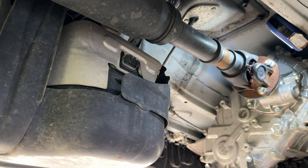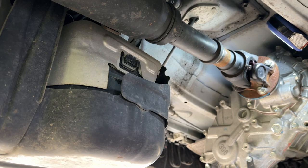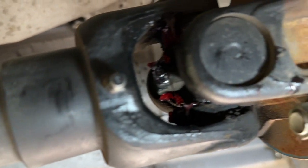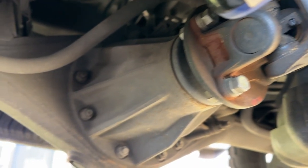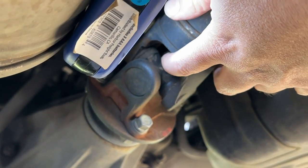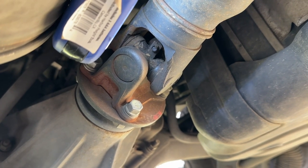Wiping up the excess grease so it doesn't fling around. Moving to the back — the zerk lined up nicely. We're under the passenger side near the rear axle and rear tire. That little nubbin right there is the zerk — that's where the grease goes. Wipe it off and shoot some grease into that one, then the whole rear will be done and we just move to the front.